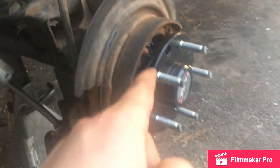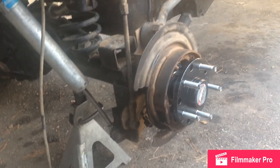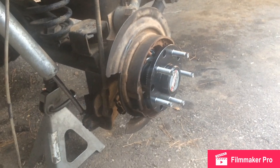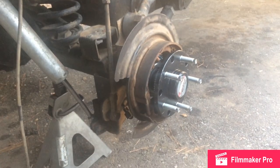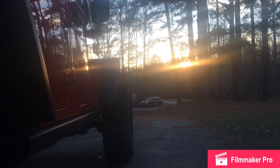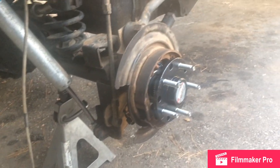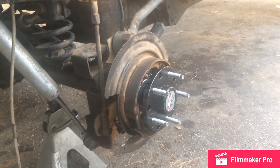Don't forget to top off a little fluid if you lost any. Now would also be a great time to change your rotor and pads — especially if you had a bent flange, because your brake rotor is going to develop that wave to it as well. So I'm going to change out my rotor and pads, top off fluid, torque everything down, and we are done with today's project. Pretty easy to do — you can do it at home in your driveway, it doesn't require many tools, and once you've done it once you're pretty much a pro.